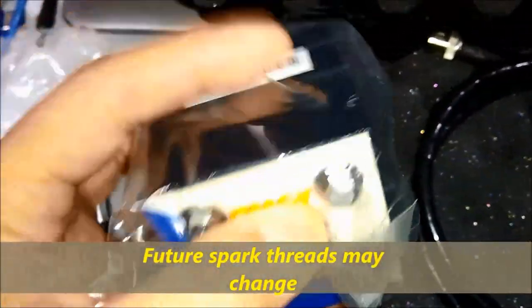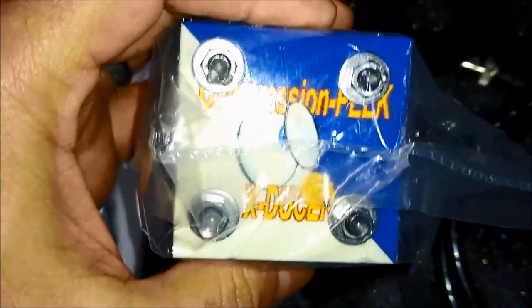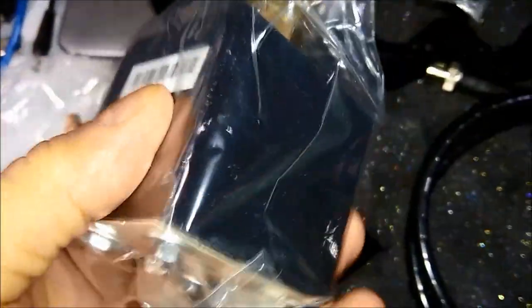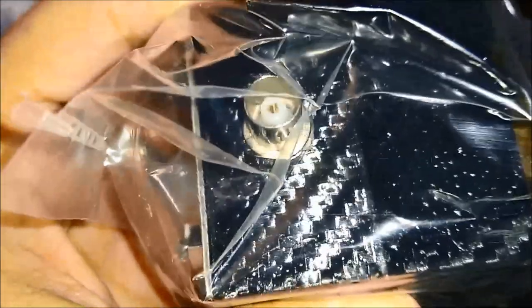We also have a vacuum peak transducer. The vacuum peak looks exactly the same, but it doesn't have the same fittings in the front. These are metal fittings made for compression. The vacuum peak has a vacuum hose output, made for vacuum. There's also a BNC connector, as you can see on screen — that's what goes to the oscilloscope.